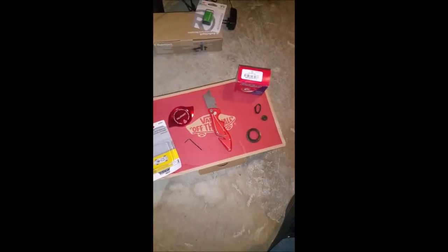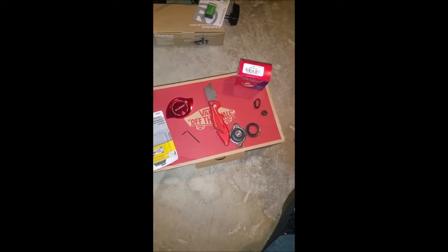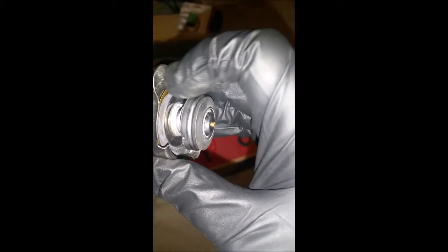This is how I built a really solid radiator cap for the 4G63. I have a DSM, and you might have a 4G63 on a different platform, but your cooling cap might be similar. The cap seals with two little overlap fins, and that tiny little gasket seals against the metal housing, which holds the PSI — the pressure of your radiator system.